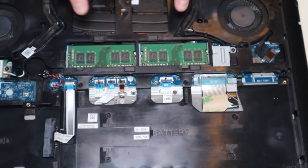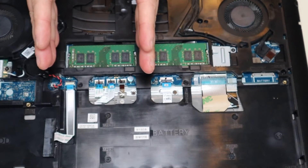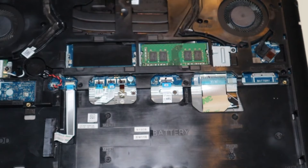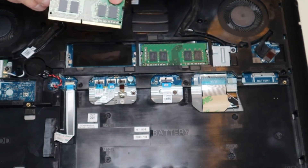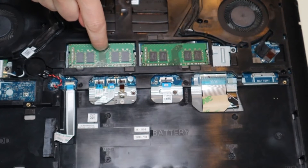To get your RAM out, slide the computer over. These are your RAM sticks, side by side. They're held in the way most RAM sticks are held in — there's a metal arm on each side that's spring loaded and holding the RAM stick in. We're going to bend those arms out and the RAM stick will release. Using my flat pry tool, very gently push that metal arm out, release it, and then the other one — and it just pops up. You can slide your RAM out like that. To put the RAM stick back in, there's a long end that plugs in and a short end, so it tells you which way to plug it in. You'll slide it in nice and flush, and then snap it in place by pressing down.